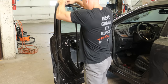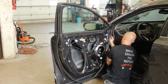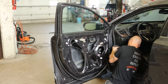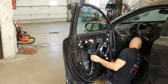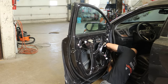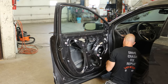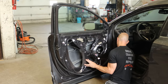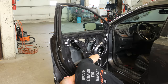After our doors are all waxed, we can start throwing them back together. We're going to put our door gasket on the front door — part of it goes back around the front edge, behind the door hinges, so we're trying to slide it back there, then behind the door check, and behind the last door hinge. Kind of like weaving it in there. We close the door a little bit to give us more room. We're going to have to unbolt our door check from the A-pillar so that we can sneak the gasket behind it — just enough room to slip it in there. Clip it into the door and we can bolt our door check back in, then put our gasket around the rest of the door.